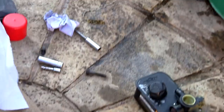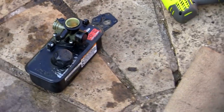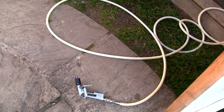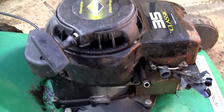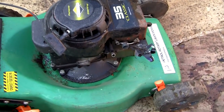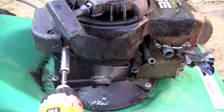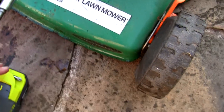That only takes a minute or so to do — I've shown that on so many videos, a lot of people know to do that. If you missed the video card, you'll find that video in the description as well. While I was off camera I just cleaned it all out and blew it all through with the compressor. But while I've got this in bits I want to just quickly take this starter recoil off here — I'm just going to blow all the inside out and have a look around. Let me just unzip this recoil cover now; just take these off and take this spark plug lead off as well.